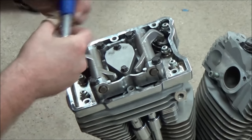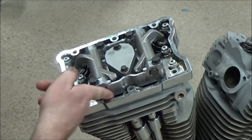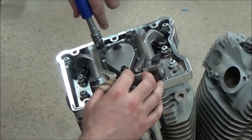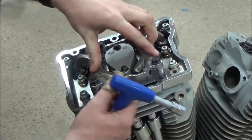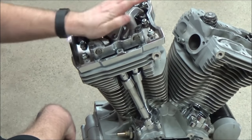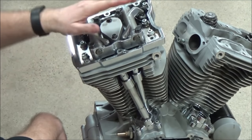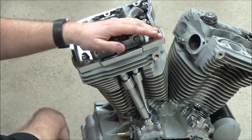Here's what we're going to do. You're going to see that there's a gap in here. It's small now. It kissed up a little. Actually, let me show something here. By just kissing those down, I can push this, and it's got a little bit of springing action. Since I can push on this, it's kind of spongy, and it won't just sit down on its own. You can actually even hear the clunk in there. That's because there's oil in the lifter. Now, this is what's supposed to be happening. This is really super small. There's not a ton of pressure on this.